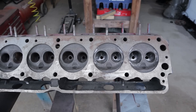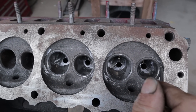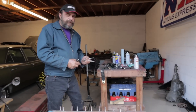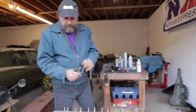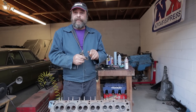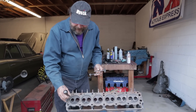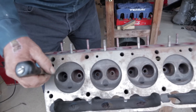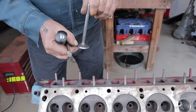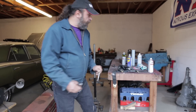We've also relieved a little bit around the outside of the exhaust valve and somewhat on the intake valve, but mostly the exhaust because it comes very close to the wall — they're shrouded. As for valves, we have a set of 170 engine builder valves, but we've decided we're just going to back-face the stock ones. According to the old Direct Connection racing manual for the slant six, it's basically a toss-up between going with larger valves or just back-facing the stock ones — probably because of the shrouding involved. You can put a bigger valve in, but the area to the outside just won't flow correctly; it'll push all of the mixture to one side. So we're going to back-face these and knock the seat down to about two-thirds of what it is now.